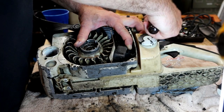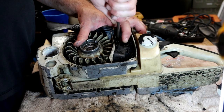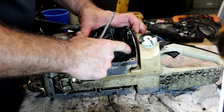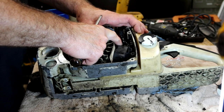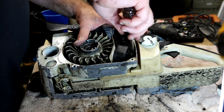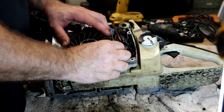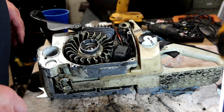That ground wire attaches to this master control lever back here in the back. And what it does is take this ground wire, run it through that switch and back up and attach to the body ground. If you connect these two places, it'll stop the spark plug from sparking. So that's how a motor, specifically this type of motor, shuts down. If you didn't have that, it would just keep on going until it ran out of fuel. It's known as your kill circuit.